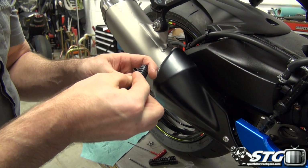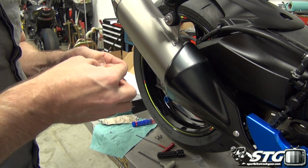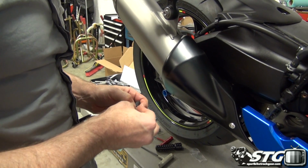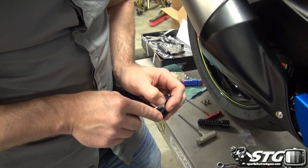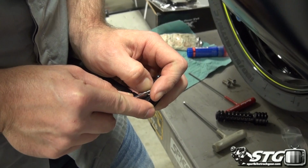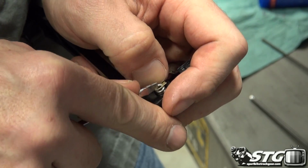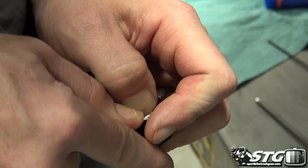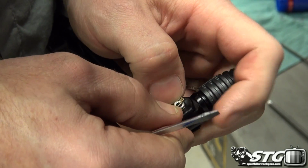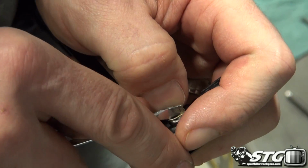Do you have to have snap ring pliers? Negative. You don't have to have them. Is it nice to have them? Yes. But I will show you how to do it minus snap ring pliers. I'm going to go ahead and hold that very carefully, right? And put a little pressure on it with the screwdriver. We can get it to jump over and then down into that lip.